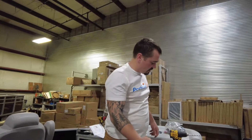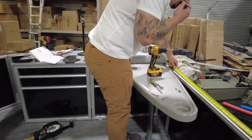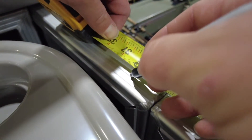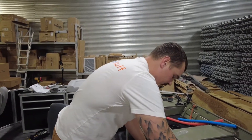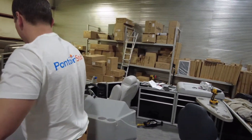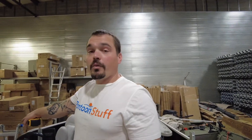We have our center supports in place. We're going to work back and then forward — 36 inches back for the next bracket. When I'm measuring, I take my Sharpie, go back 36 inches, and make a little mark. When I put my next bracket on, it'll just barely cover that mark so I know I'm in the right position. We do the same thing going forward to our front brackets — this time measuring 38 inches forward. Make my mark at 38 inches from the front of the bracket, and we'll do the same on this side. Then I repeat the same steps — drilling my hole and bolting through on the front and back supports.